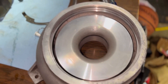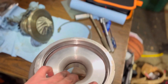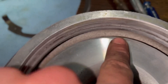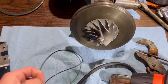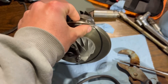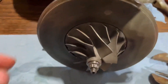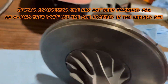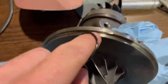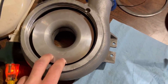Next we're going to be putting on the compressor housing. Assuming you're reusing your old one, just go over it really well, make it nice and clean — you might as well do it now while it's out. Try to get the insides here too. It's going to get carbon buildup again, but it's better to get out most of it now. The next step is to put this O-ring on the outside of the turbo core compressor side, but that O-ring only works for things that were machined. This turbo hasn't been machined here, so that means it's a metal-to-metal seal as opposed to using the O-ring.